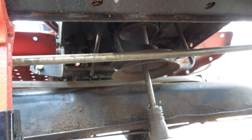I got this pulley assembly off, cleaned it all up inside, I've got some anti-seize on the shaft and on the bolt, and I've got my new belts ready to go. If you're ordering belts, make sure you double-check and get the right mesh belts for your machine — yours may be different. I found these on eBay and got a good deal — found a seller in Quebec, this one for $15 and this one for $10 with good shipping. Amazon had a pair for about $50, and at a resale store you might pay $40 or $50 a piece.